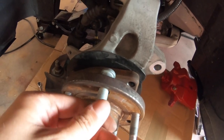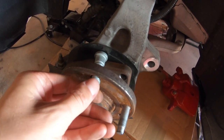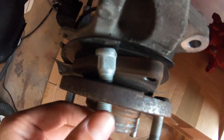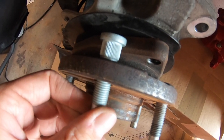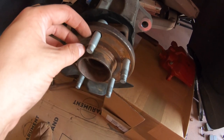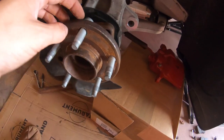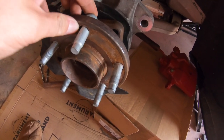So as you can see, the lug bolt is in place. It's still movable so I can spin it around. We just have to make sure that the flat side is in the right position, and then we'll get a bunch of washers or a spacer of some kind, and then a lug nut, and then we pull it so the spline seats into place.